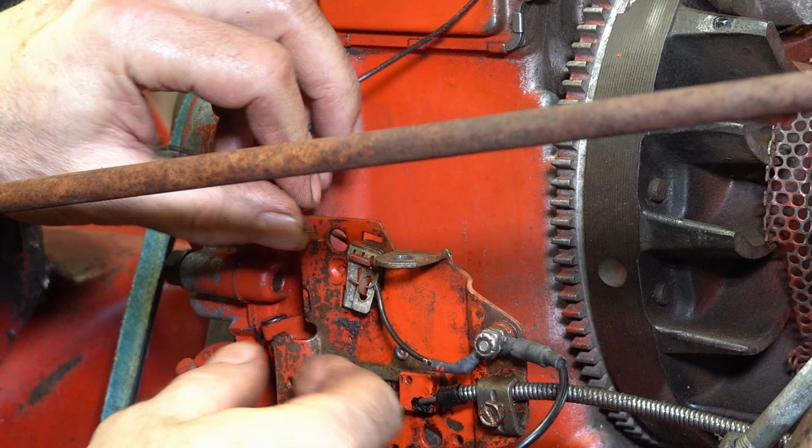Well, the bolts, now all that lubricant. See, I managed to get a lot down there. All right, I'm going to blow that out and see if I can put a tap in it. Get this baby cleaned up. All right, I'm going to run a 5/16 down here. I blew it out, and I ran the bolt on the wire wheel, and I even ran a die over it just to make sure, because there's a problem here. I think this goes into the exhaust port a little bit, because when I blew down, it felt like it came out from here.